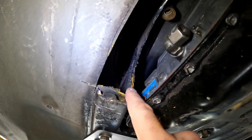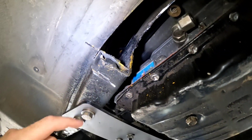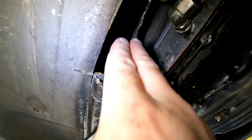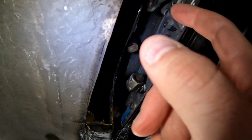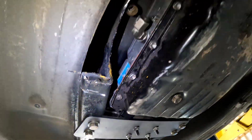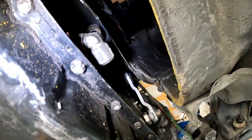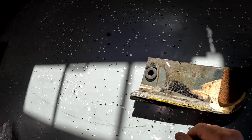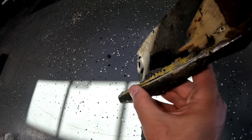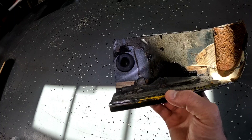You can see I cut into the box structure here. The way this subframe works is it pretty much tapered off right there anyhow. When I come back through here, I'll put a piece of thick plate and build a box structure over top of that to put all that strength back in — it won't be a problem. We've got quarter-inch plate here, so I'll make that all pretty. I'd say I took about a two-inch by four or five-inch piece out of the car.